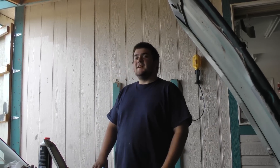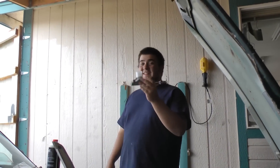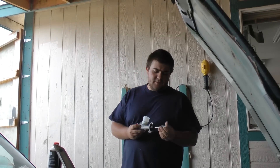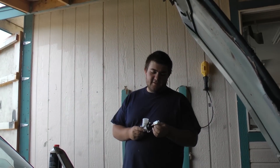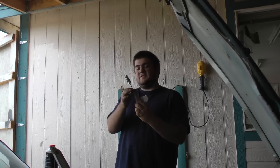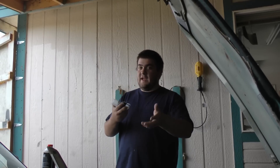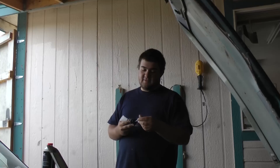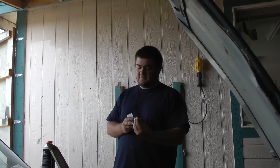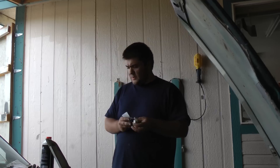This is Brandon from Budget Boosting. Today we are going to talk about how to replace your master slave cylinder. These typically go bad if you get a leak in your car, or this rubber seal sometimes just blows. What happens is you push on your clutch pedal and there will be nothing there. Sometimes this is the cause — there will be other causes, but we will cover this one today.